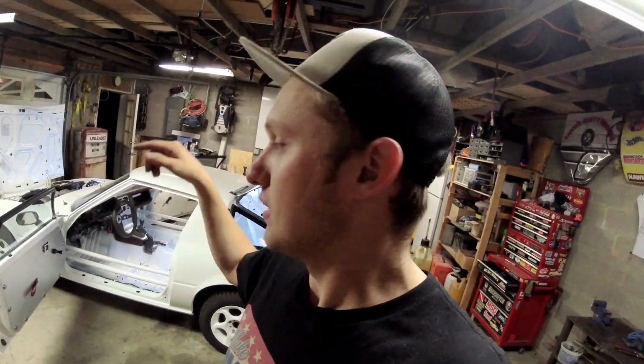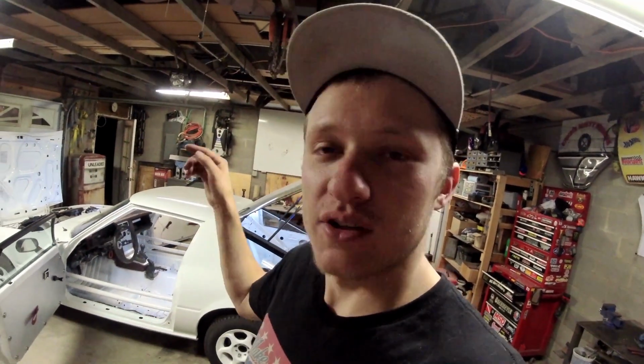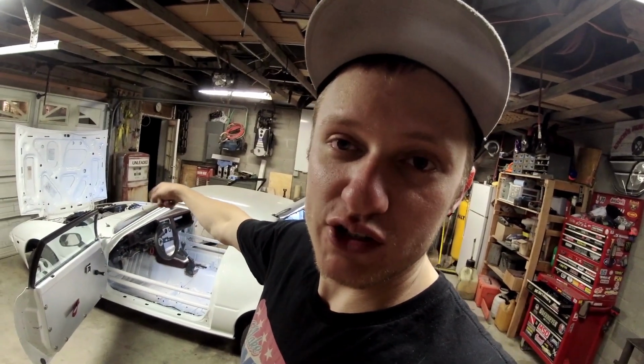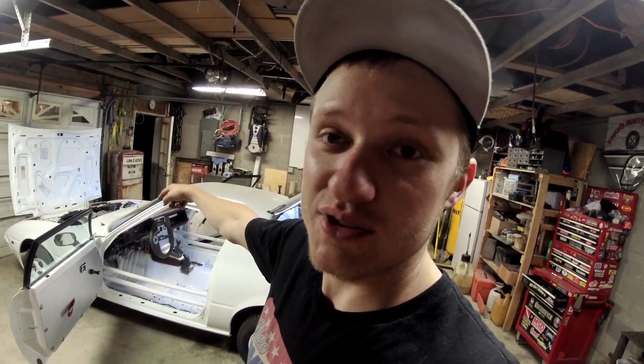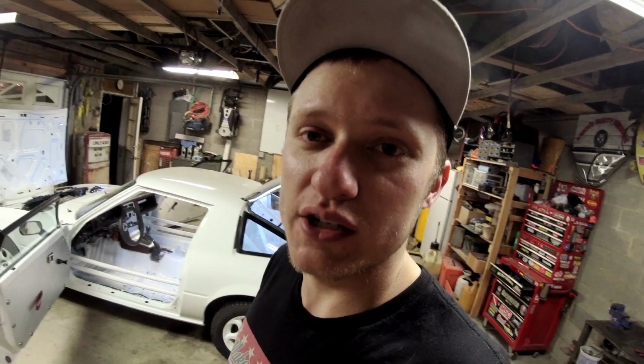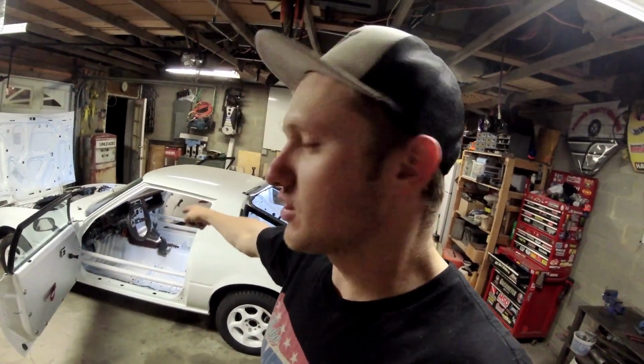They are the bomb. And on these low horsepower cars, you might be like, oh, well, the 10 extra horsepower. All right, you can throw a gravel piece an extra 3 feet. But when your car is overheated because you ripped the electric fan wiring off on a stick and I'm still cruising past you with my belt drive clutch fan, ask me how I know about awesome 2 extra feet of gravel throwing or whatever. I don't know. You get the picture. Clutch fan, more reliable, simpler, easier. Run it. Keep it stock.